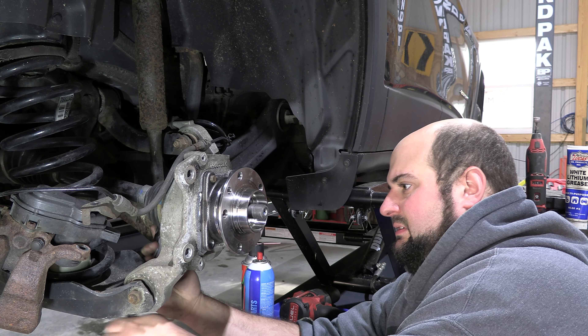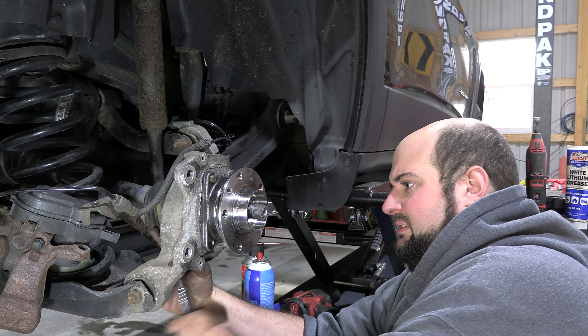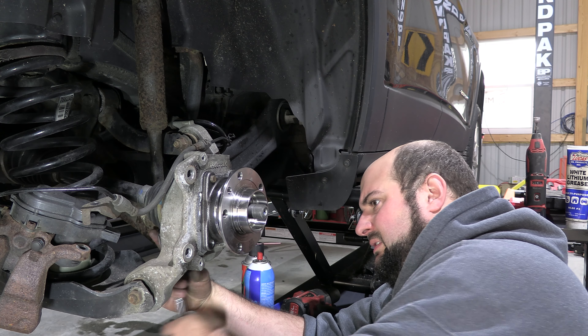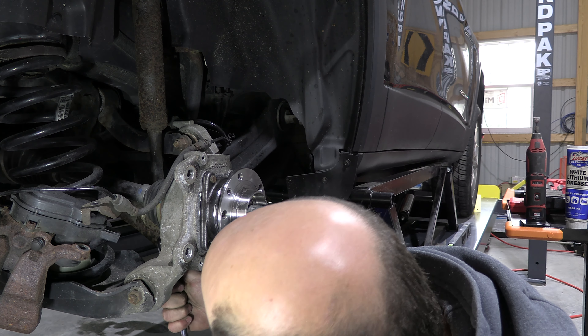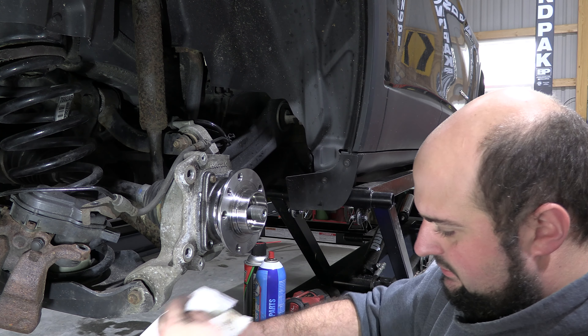What failed on the old one is this rubber ring — it kind of let dirt and moisture get in there, which I believe is why that bearing failed. We've got this brand new one that's going to go on. It should go on — there we go, just like that. We'll have to tap it into place and probably suck it down with the impact gun and the nut on it too.